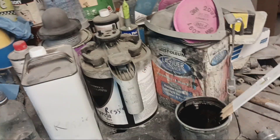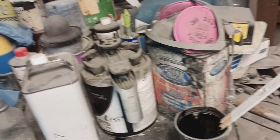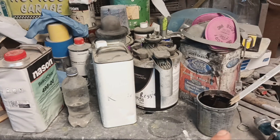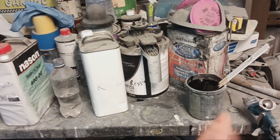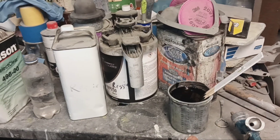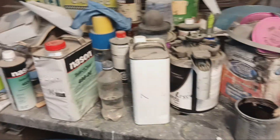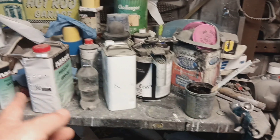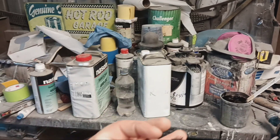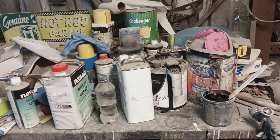You've got a rule of thumb: wait about 10 minutes in between your base coats. Spray your base, wait 10 minutes, spray another base, wait 10 minutes. Do three wet coats of base, three wet coats of clear. 10 minutes in between or so — when you go more it's fine, don't go less. You want it to flash out and dry. Then when you go to the clear, wait 15 minutes from the base coat to the clear coat; that gives it time to harden up. If you spray clear over wet base, it'll look like brake fluid got on it and it'll wrinkle up. That's called frying. You don't want that — you have to stop and start all over again.